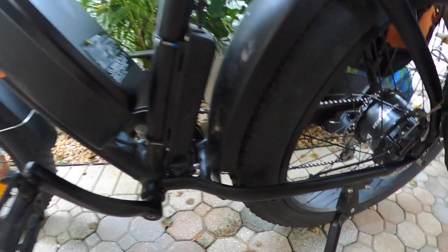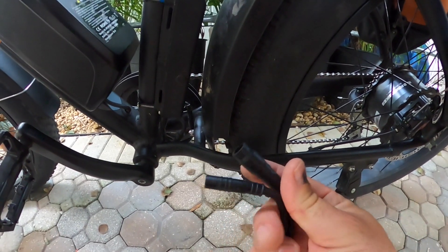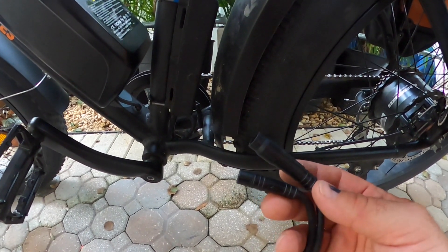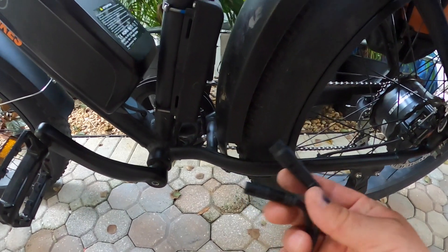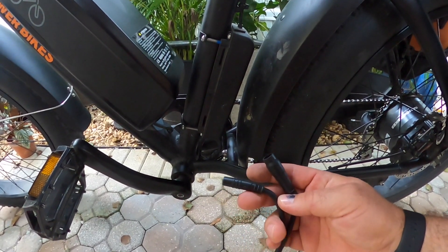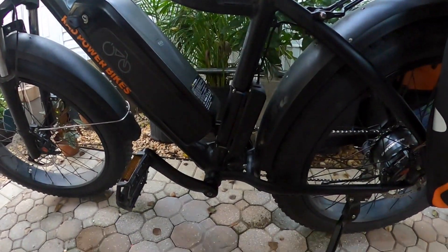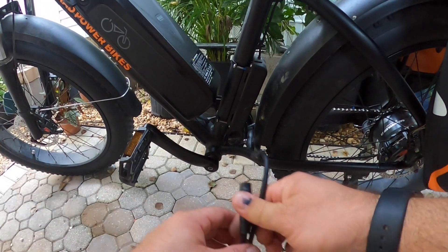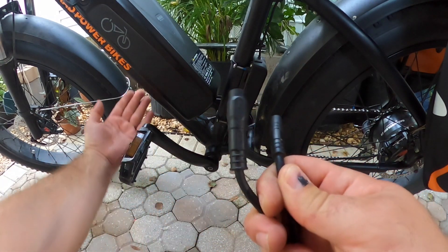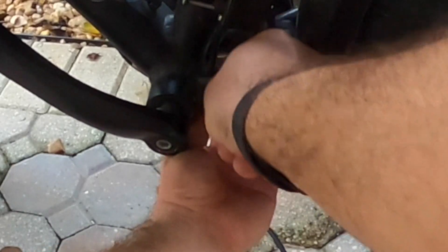This is the connection, and these are your two cable ends for your XT60 extensions — custom for RAD. These are the male ends for the female ends on the RAD custom hookup from battery cable end to your controller. We're going to unplug these, do the reverse setup, and get him set up with a 40 amp dual battery discharge balancer. You're looking for the equivalent of these ends where the cabling wraps right underneath the frame — and we know that's right here.